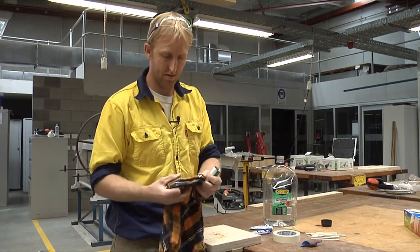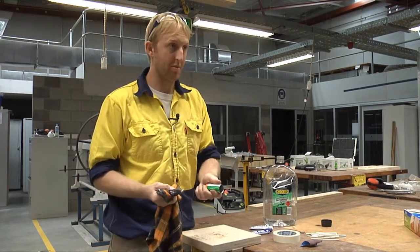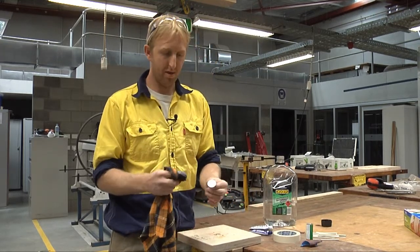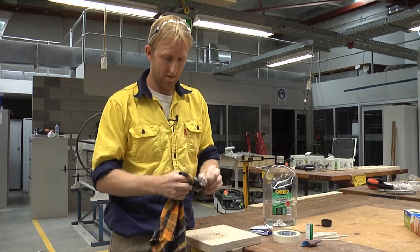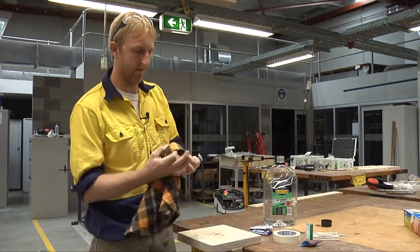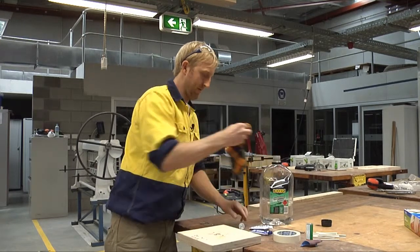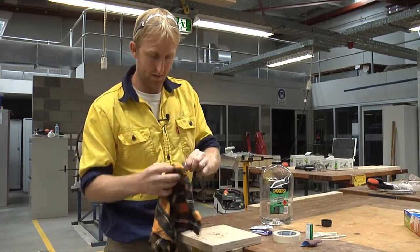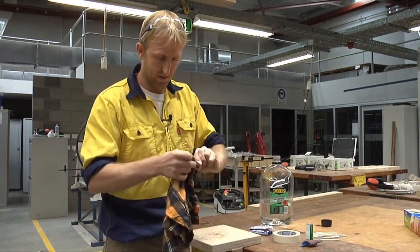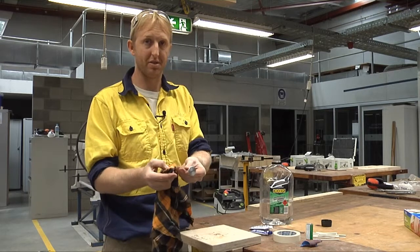That's pretty clean, we'll just have one more go on it. So once you clean this you don't actually touch it again because you'll contaminate it — so that part's clean. Next part we're going to clean is around here. If you've used all your methylated spirits on the rag, grab a little bit more and just wipe it all the way around there. Get it right in the shoulder there. Same again, don't touch this once you've cleaned it.